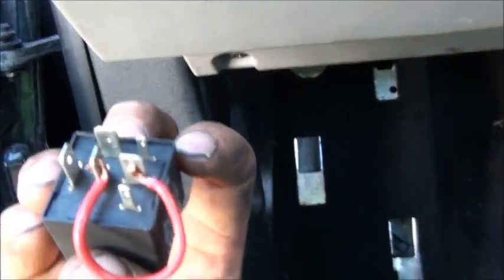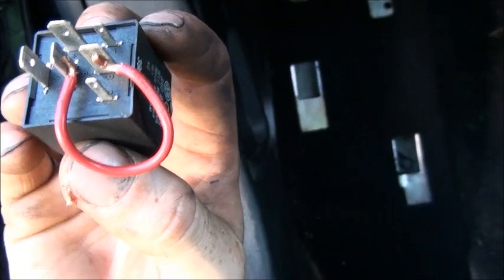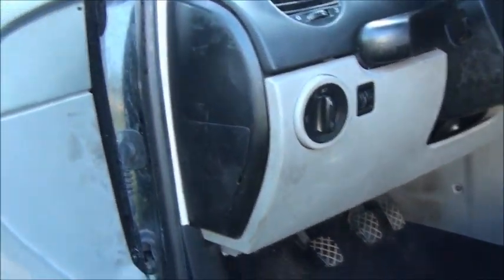So what I did to bypass that — relay 173 right there. What I did was take that relay and do this just to get the daytime running lights to actually come on. I'm wondering if that has something to do with our issues, why we're not able to get some of these lights to work. There seems to be no power being sent back there — maybe it's robbing the power.